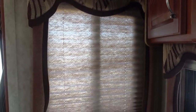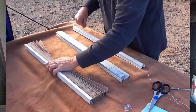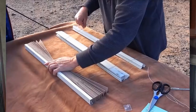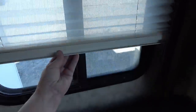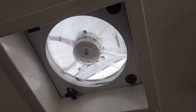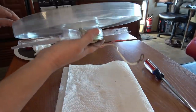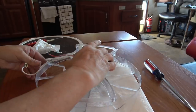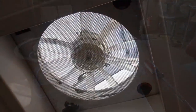Another repair about a year ago was to restring the blinds — the strings that run through had broken, so I bought a blind repair kit with new strings and learned how to do it myself. The kit has extra strings, so if any other dual blinds go I can repair them. This one has been functioning well for the last year. One repair that hasn't totally worked out is the ceiling fan — there's still a little squeak in it. I took it all apart and tried to get lubricant into the bearing, but it's a sealed bearing with a little play in the motor. I've found a replacement motor online for about thirty dollars, so I'll order one and throw it in.